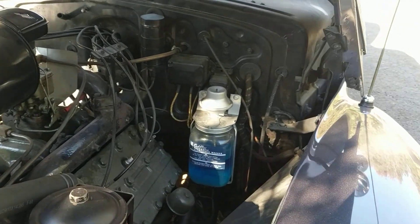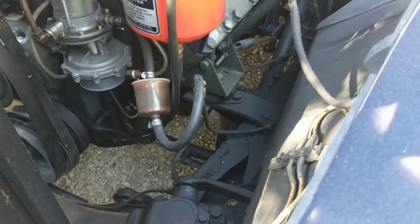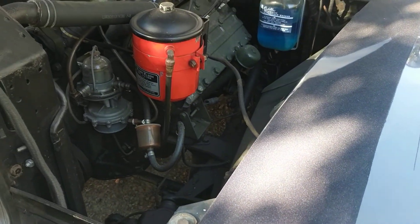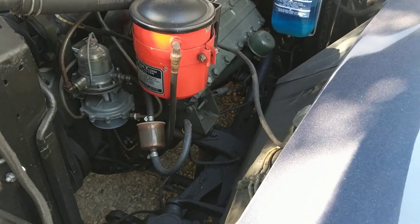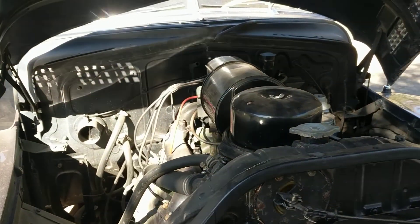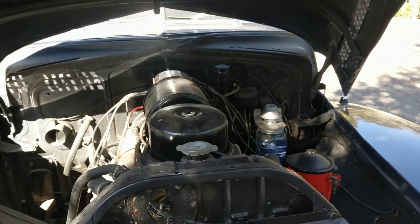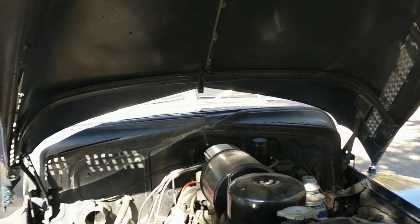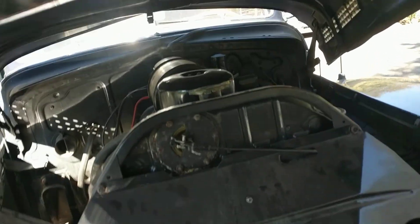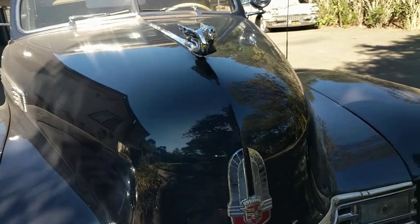There are just some hoses and wires that are not quite the way they should be. I tell everybody, always replace the fuel lines and hoses with modern gas hose that's fuel safe. Basically, if it's labeled fuel injection hose, it's much better than the old gas hose you get all over the place. The rubber up there on the cowl is loose. Hardware just needs a lot of general cleanup here under the hood. So let's carefully close the hood and latch it down, and we'll move along.